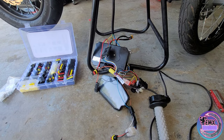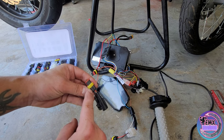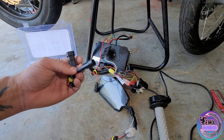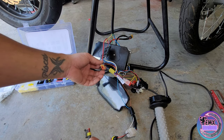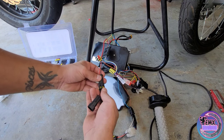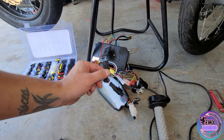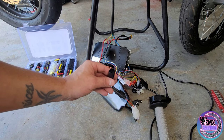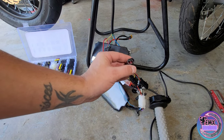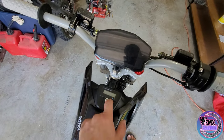What I wanted to show you guys is I made this splitter right here for the key. Basically it's just two positives going into one side, two negatives going into the other side — one two-pin connector going one way and one going the other. So when I plug this into where I rob power from the key switch, I now have room to plug in not only my DKD display but also my voltmeter for accurate voltage — or later on I can use this to turn on my 12-volt reducer, turning on with the key switch and sending clean 12-volt power.